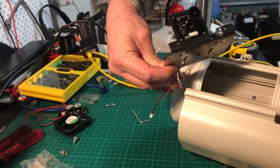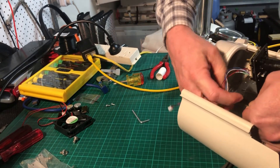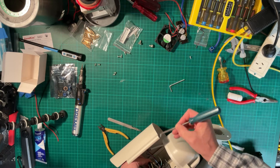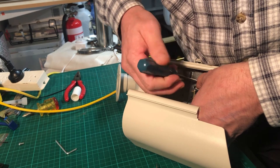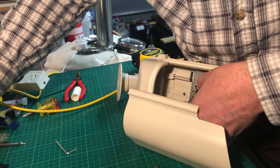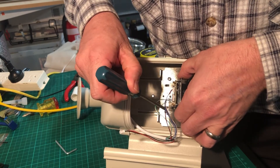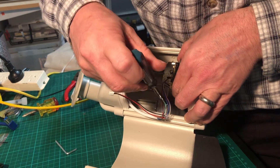Now you've screwed the lens to approximately the right length, you'll be able to get the camera as close to the security camera housing window as possible and use the two screws to mount the plate in place. There are two channels in the bottom of the housing that the screws are going to screw into. The PoE cable for the camera has already been threaded up through the security camera housing and plugged into the camera board.